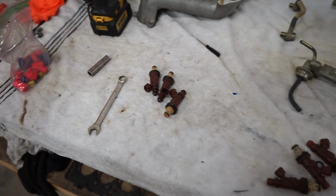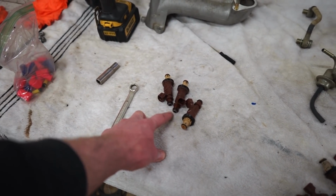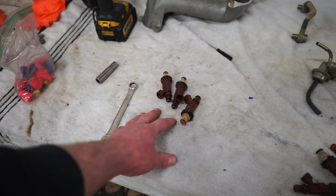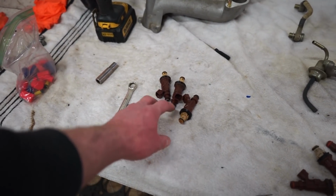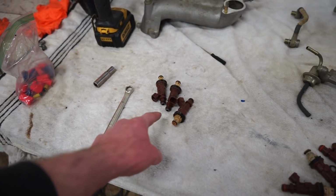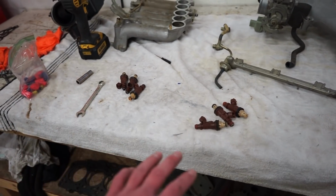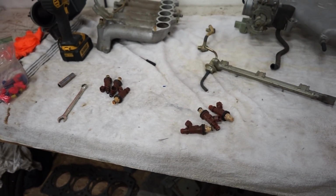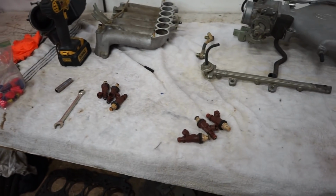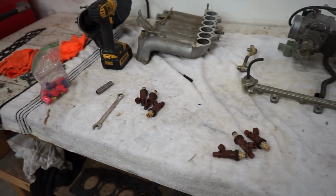And I know you guys are gonna say you should have done it right the first time when I swapped these three out, but a subscriber sent these over for free. It was more of a test to see if the injectors were bad, and just changing these three injectors made an insane improvement at how it runs. So I think once we get all six brand new flow tested injectors, this thing should run like brand new. So we'll get back out here in, I don't know, a week, whenever we get the new injectors in, and we'll get this thing back together.